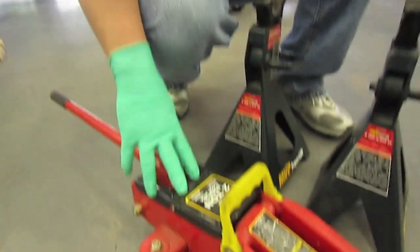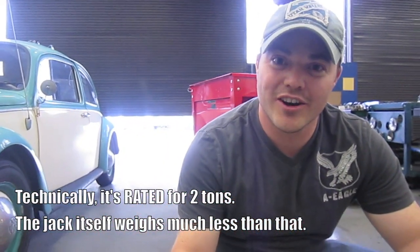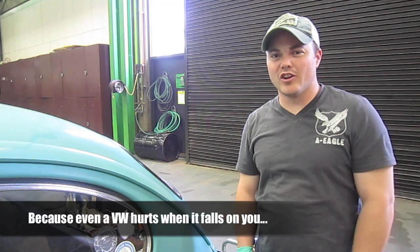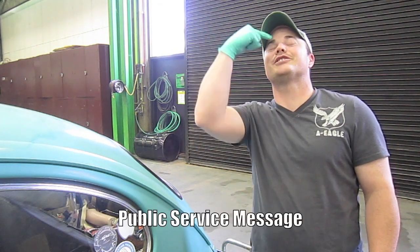Since you're going to be lifting the car to do the project, you're going to want a jack. This jack is two tons, which is more than enough to lift this car — but lift, not hold it up. In order to hold it up, you're going to want jack stands. Speaking of stuff falling on you, you're going to be under your car looking up where things are going to come down and hit you in the eye, so protect your eyes.